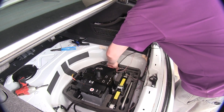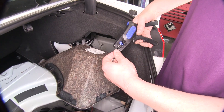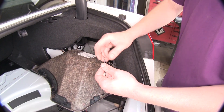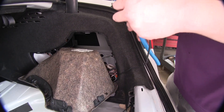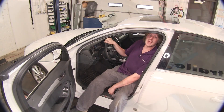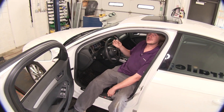Now we're just going to route our wire over to where our module box is. We'll strip back the other end of our wire, put a yellow butt connector on this end, crimp it down, and then crimp the other end with the black wire coming off of our control box. Now before we tidy everything up, we do want to make sure everything is working properly.